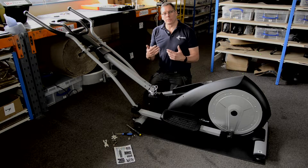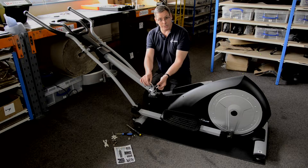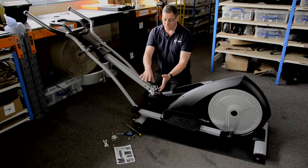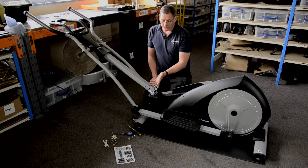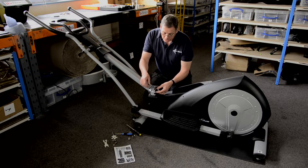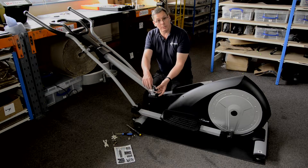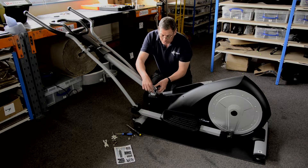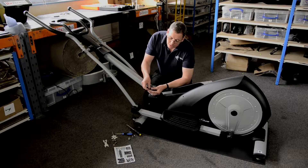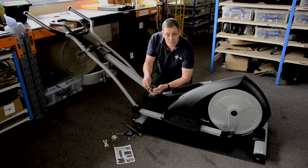So I'm kind of thinking, well, what's the most likely scenario? The most likely scenario is maybe I've damaged a connector or a wire here. So I've already taken this column joint apart and you can see the wires here. I've checked my connections and I've checked the wires. The wires actually look okay. It doesn't look like I've got any of those snagged, but when I've come to inspect the connectors, it looks to me as though I've inadvertently connected one of the connectors around the wrong way.